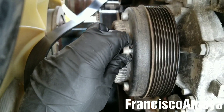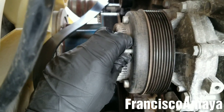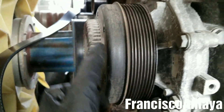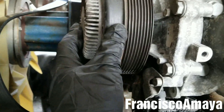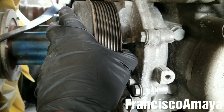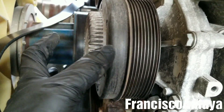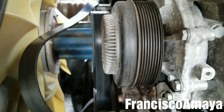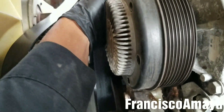To remove the pulley that holds the water pump — all the bolts are now removed. I made a mistake: I said there were five bolts but in reality there are six bolts, so I'm sorry about that. Now it's time to remove the pulley. In this case the pulley is stuck because this part is aluminum and this is metal, and these two components don't get along — they get stuck after many years of use. So I'm going to be using a rubber hammer to hit it and get it out. See, it's coming out now. You've got to do that otherwise you won't be able to get it out. And it's out.